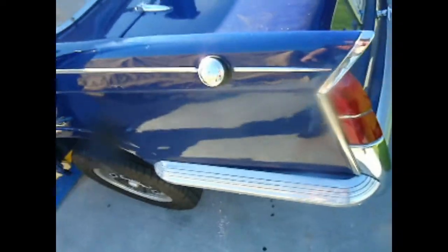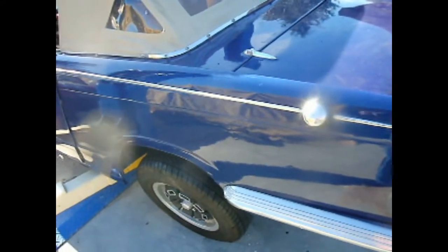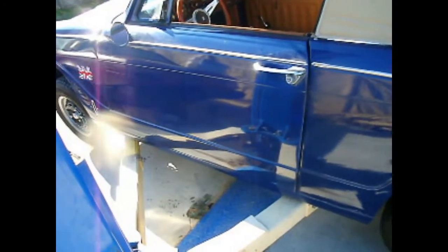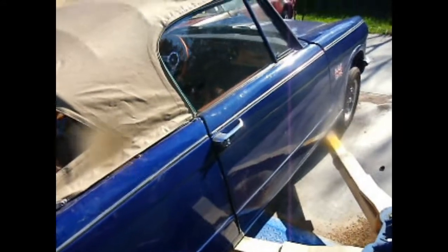It's obviously not a stock color paint — this is from NAPA Auto Parts. It's a sleek color, metallic blue with a little bit of cyan in it, so it's kind of got a purple hint in the sun. And of course, the dual exhaust. Pretty nice car — I really like it. The stock GT6 motor made about 90 horsepower or so, but between the header, the improved carburetion with bigger carburetors, better cam, and it's blueprinted and balanced as well, I figure about 120 horsepower. It's not crazy fast, but it's peppy and fun. It's got the GT6 transmission — all-synchro four-speed with overdrive in third and fourth, so it's effectively a six-speed transmission.